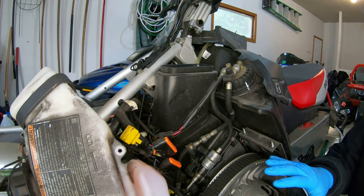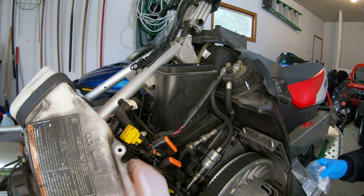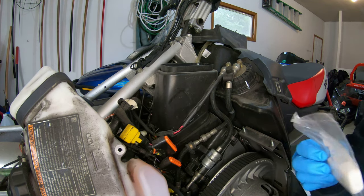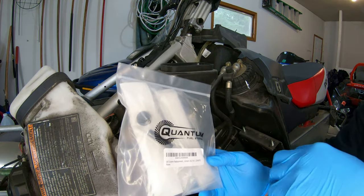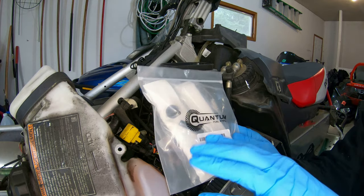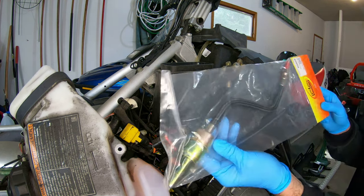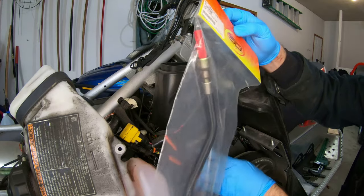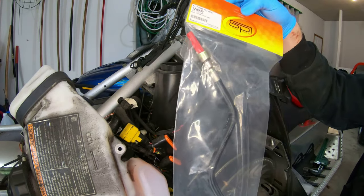It's a few days later. I got the parts in to fix the Switchback 600 here. I'll show you what I picked up. We got a genuine Polaris fuel float for the float gauge. We got the fuel sock strainer for the bottom of the pickup of the fuel pump — this is the three pack, which was like 16 bucks, way cheaper than genuine Polaris. I'll put a link in the description. And then I also got this new fuel filter, which I'm thinking is probably the main issue — it's going to be plugged. I'm going to see if I can tell if this one's plugged by maybe just blowing through it. This is the part number for that. I'll put a link in the description — I got this off Amazon as well.